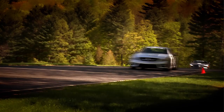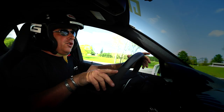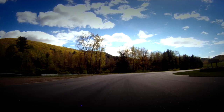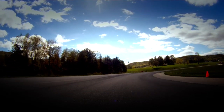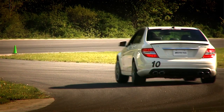Our first run is going to be in our first traction control mode. Basically, what it's going to do is not allow the car to break much traction. Once it gets to a certain yaw — after just a few degrees — the computer will kick in and say, that's enough sliding. As we build up the pace here, I'm going to try to slide the car down at turn three. Basically, no matter what I try to do, it's going to make it very difficult for this car to slide.